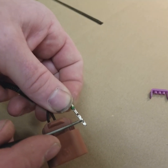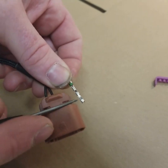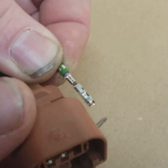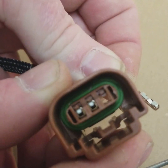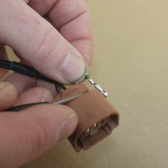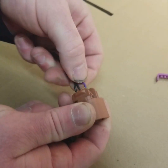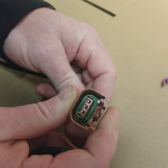Make sure the opening in the pin is going to the side where the lock is in the connector, because that plastic lock actually grabs onto this portion of the pin. So I'll just go ahead and slide that back in there — you heard that little click, it's definitely clicked in.